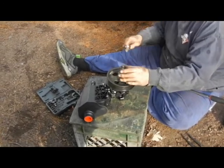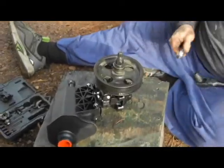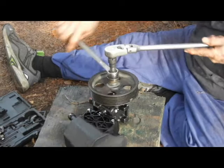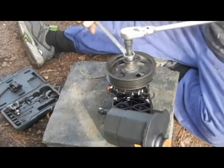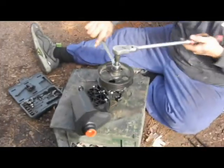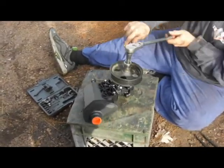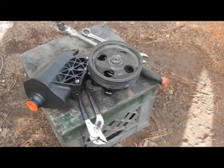The tool is set up with a bearing on the bottom and a washer on the bottom so it's thin. We'll press the pulley in. Check the back side and check your progress. Fully installed on the pump and ready to put the pump in.